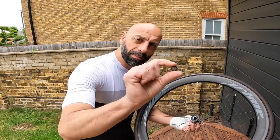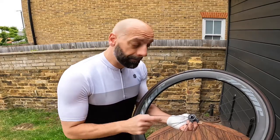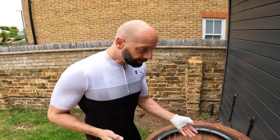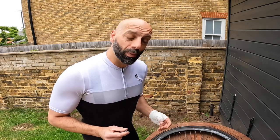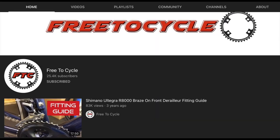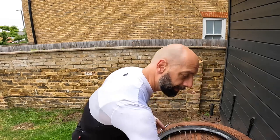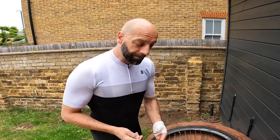These are the small bearings fitted in the front wheel. I actually managed to remove the bearings — it wasn't that easy. I found a couple of instructional videos: first the Prime-owned ones where they show how to remove the axle. They gently tap it and it comes out straight away, but maybe they were working on a new wheel. If you've been using the wheels it's not going to come out that easy. I really suggest watching the videos of the free-to-cycle guy — extremely knowledgeable — and with a bit of initial persuasion, and much stronger persuasion, I could get the axle and the bearings out.